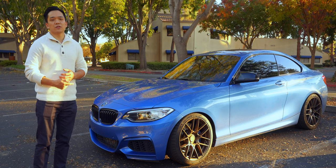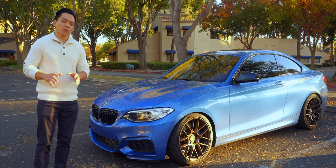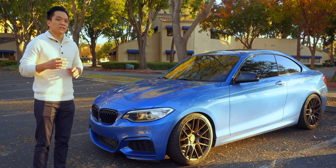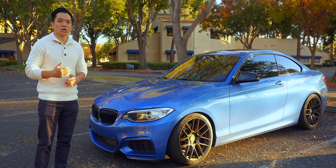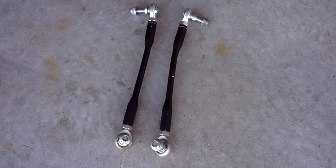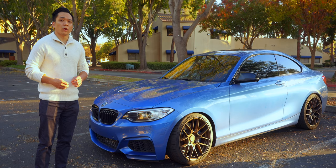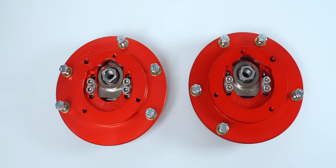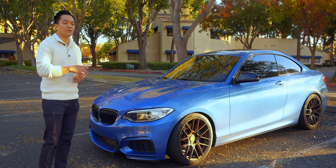And just like that, we've installed the KW DDC kit on the BMW. Even if your car doesn't have factory EDC installed, KW makes this same coilover set in an adaptable fashion that can be fitted onto any BMW. To note some important things with our setup: the mounting point for the front sway bar end links has changed, and even with our adjustable end links fully retracted, they don't fit — mine actually bent. So I had to call SPL Parts and custom order a set of end links, and I'm currently working with them to have something up on the site so you have the proper end links to pair with this system. Second, the Vorschlag camber plates were custom assembled to fit this car and to adapt the retrofit we have on the way — another suspension modification going inside the engine bay.